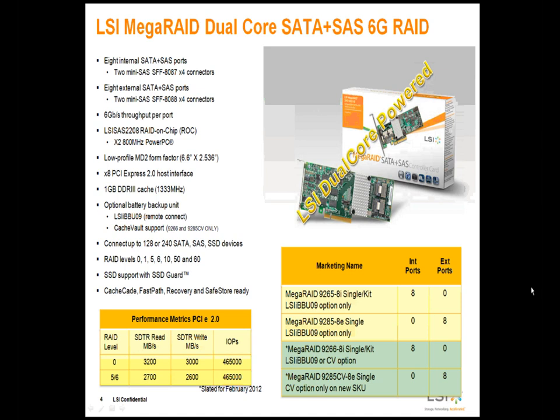There were 8 SSDs, and depending on the SSDs you get, one of the things about SSDs is that you want to focus on enterprise level SSDs. They'll provide much more performance and reliability. If you go for a true enterprise level SSD, even with just 8 you can get upwards of 400,000 IOPS. And it all depends on your exact IO load and your IO pattern. But the possibility is there.